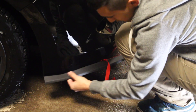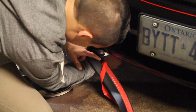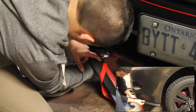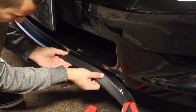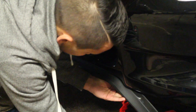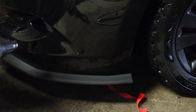Work your way around the front of the bumper and keep applying pressure on the bottom. If your bumper has any complicated curves, make a V-cut into the top part of the tape to allow the lip to conform better. If you want to see a better example of this, click on the annotation right here on your screen and it'll bring you right to my other video showing you how exactly to do this. Keep using the heat from the heat gun to make sure the lip sticks properly and work your way around to the other end of the bumper. Take your time and make sure it looks perfect, because once you've got it adhered to the bumper, you won't be able to readjust it, so make sure that you're happy with how it looks. Once you're at the other end of the bumper, cut any excess lip that you have and go back over the lip and push it down to make sure that it's on there for good.